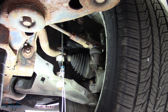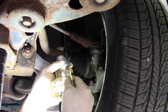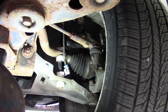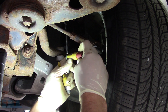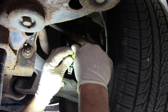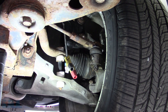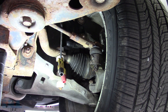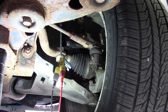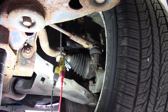However, I'm a pretty smart feller once in a while. I know that these connectors here are typically garbage. Usually, if they're not all green and crusty out here, you can give them a little tug and they pop apart. Or we can use our Pomona probes, which you can buy at AES Wave also — my favorite back probes, or wire piercers, call them what you want. We're going to pierce in there, and that's going to tell us if our connection is bad between point A and point B. We'll jab these little guys in right there. So now we've eliminated the front connection, and lo and behold, we are now going 50 MPH on the right front wheel by injecting the signal directly into the wires instead of into the connectors.